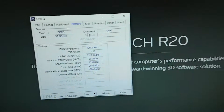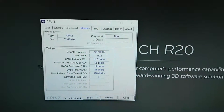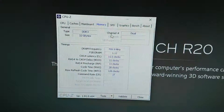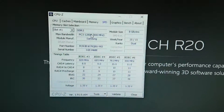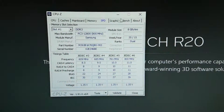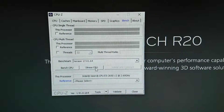From the memory side, everything's running in dual channel, which is actually not too bad. Dual channel works just fine — quad channel is obviously better — but for the price I'm not going to pay $50 more for a motherboard just to get quad channel. I'll try to overclock the Samsung memory in the BIOS to 1866MHz; right now it's running at 1600MHz.